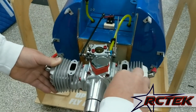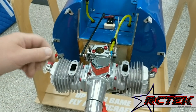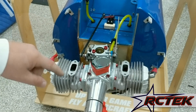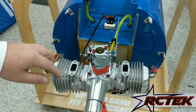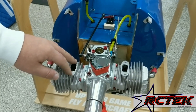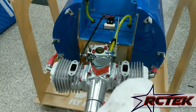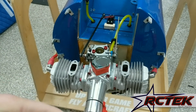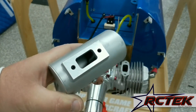Since this engine has been used, I highly recommend getting some Q-tips, soaking them with alcohol, and running them down into the threads. The Q-tip will drag any dirt out of there — it'll take several of them to get the job done. When they go in and come back out clean, that's when you know you're good. That will help your bolts stay stuck. If there's grime in there, you're setting yourself up for failure. Then take the rag and clean the mufflers too, get all that sanding residue off for a nice shiny surface.